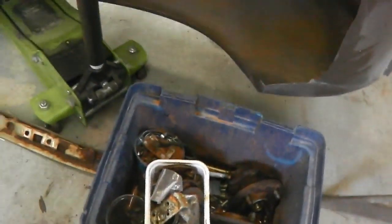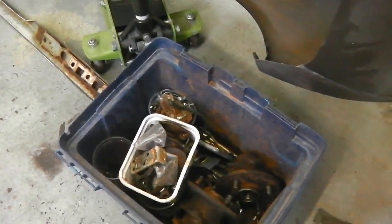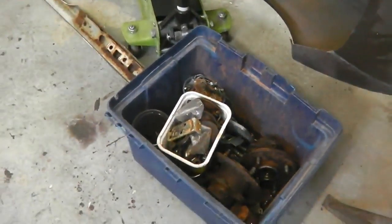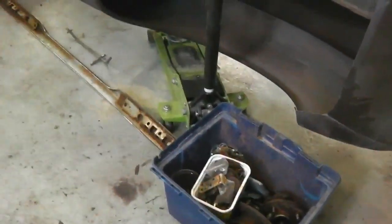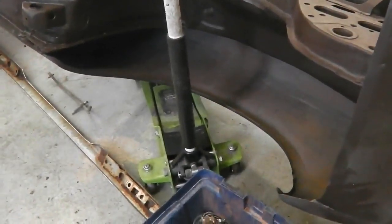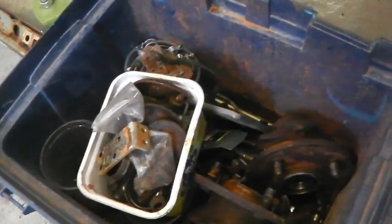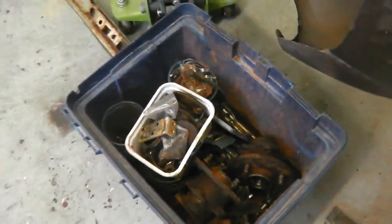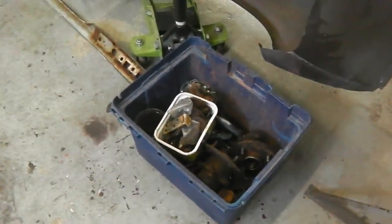Talking of the rest of the equipment, we want to be getting that axle in here as well and get that shot blasted down, because again, speaking of the Frost products, we use the chassis black gloss on the axle because we don't like stripping them. What I'll do is run that axle, blast it back, and then paint it with the chassis black paint. Then we'll see if it's a noisy one, then it gets stripped, because it could be really good and you've wasted your money.